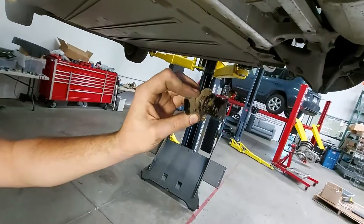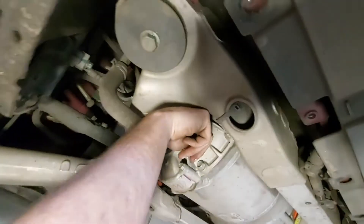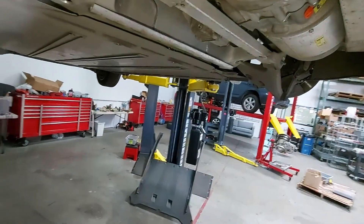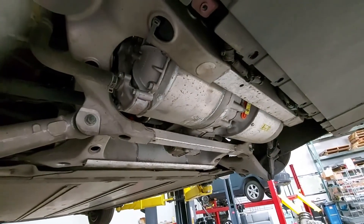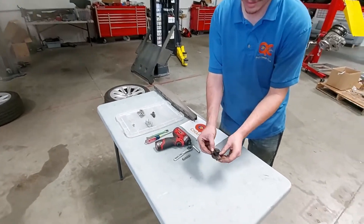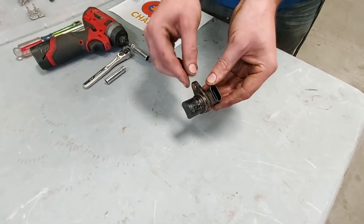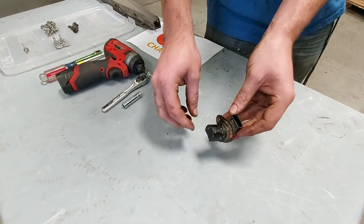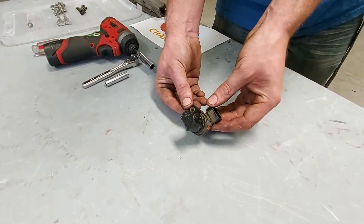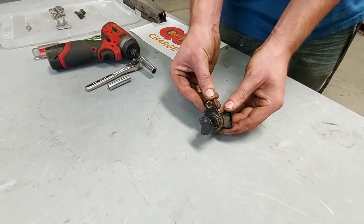There — you can see our sensor. You can see it's got some goop and some coolant on it, which is not such a great sign. You can also put your finger inside the hole and you can see there's some moisture in there. This car is going to be getting its drive unit rebuilt to fix that issue. The coolant on the sensor means that coolant is leaking from the rotor seal, and the brown residue is probably a combination of grease as well as corrosion from inside the rotor that gets ground up and creates a buildup of goop. If you see anything like this, your drive unit definitely needs to be taken care of.